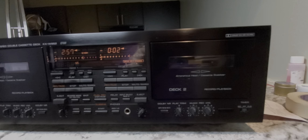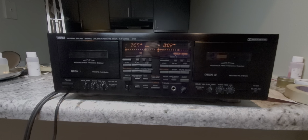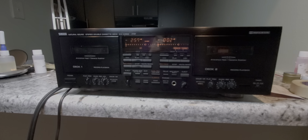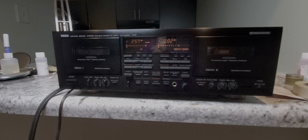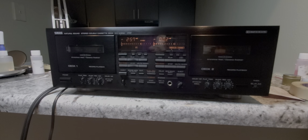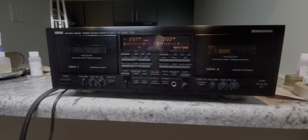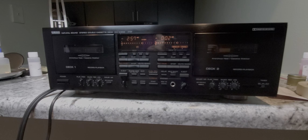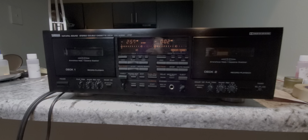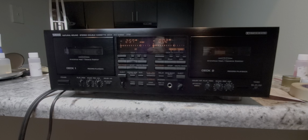Totally autonomous from the other one, running off a common power supply. The thing that really impresses me about this machine is just the overall execution. I've had other cassette decks in the past, but this one for its price point really hits above its weight class. Details like an anti-resonance sub-chassis just above the floor plate to quell unwanted resonances — it's a nice detail. I expect things like that from a Pioneer Elite with their honeycomb copper sub-chassis.